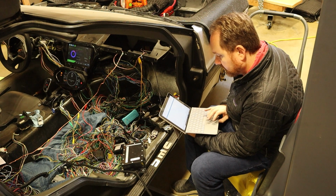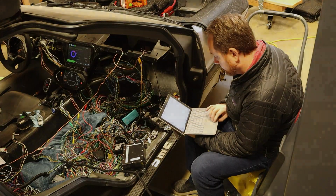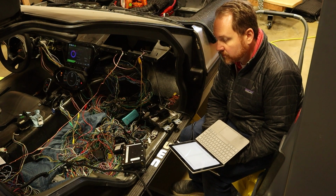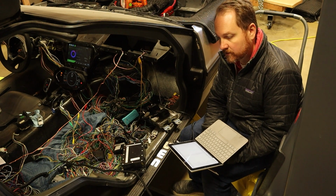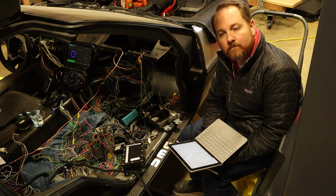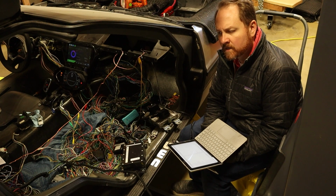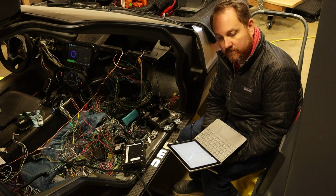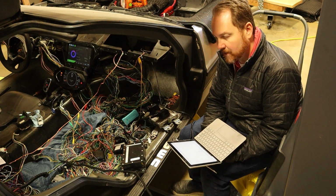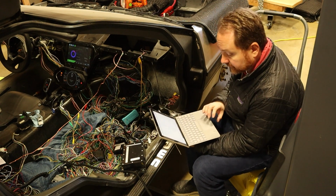I'm just going to confirm that all of them are good, there's 3 pages of them. I'm just going to go through all of them really quickly. Oh man, who would have thought that it was just the stupid headliner harness that was preventing all of this from working? Well, actually, I guess that's not quite true. Even if I would have put the headliner harness in, it still wouldn't have run because the AC compressor wasn't there and the power steering wasn't overridden, but tracking down the headliner harness was a bigger pain than all of those other things.